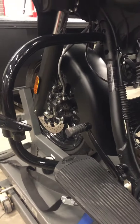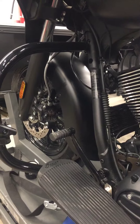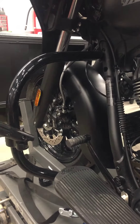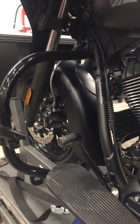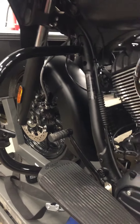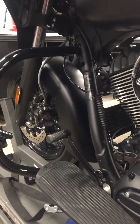The tire pressures were a little low in the front. That might have been what you were feeling on your loose steering head. We like to run these at about 42. That'll keep your tire pressure sensors from going off, especially if it's a little cold outside.